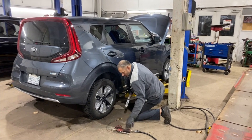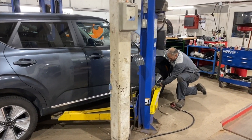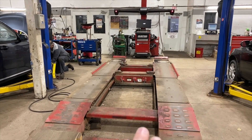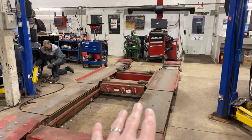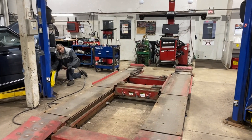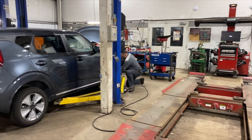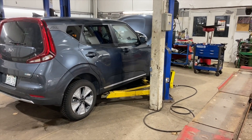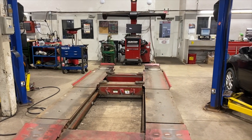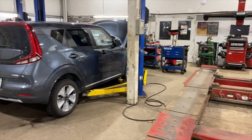A couple of services we didn't cover today: you can balance the winter tires when you do a swap — we often offer that to customers. I decided to decline since these tires have only had one winter on them. The other great-value service is the alignment check — we can put the car on the alignment rack, which laser-measures to the hundredth of a degree to make sure wheels aren't tilted or facing the wrong way. It catches alignment issues before you have tire wear. At Brantford Kia we offer a no-charge alignment check with any service — you get a printout. We'll cover that in another video.